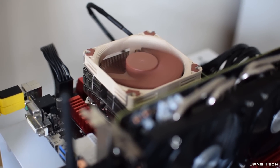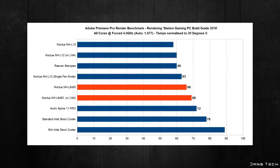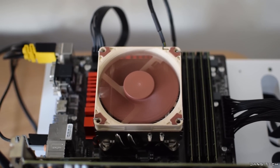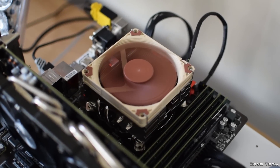Moving on to performance — testing this cooler on my i7-4790K with all cores locked at 4GHz and automatic voltage set, the NH-L9X65 is able to keep the CPU running at a surprisingly cool 66 degrees Celsius. This is while running my usual benchmark of rendering out the intensive 2016 how-to-build-a-gaming-PC guide in Adobe Premiere Pro CS6. As for performance with the low noise adapter attached, the temperature increased to 69 degrees, so not quite as good, but noise levels did decrease by a small amount.